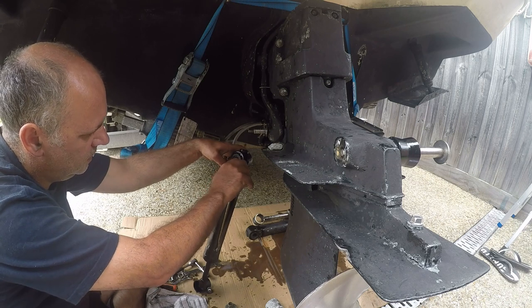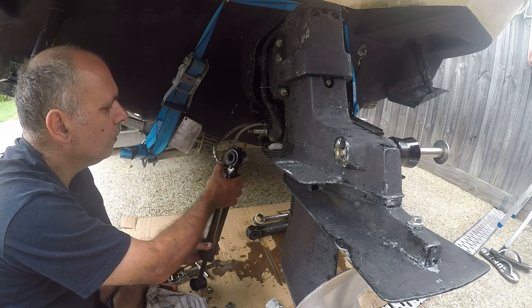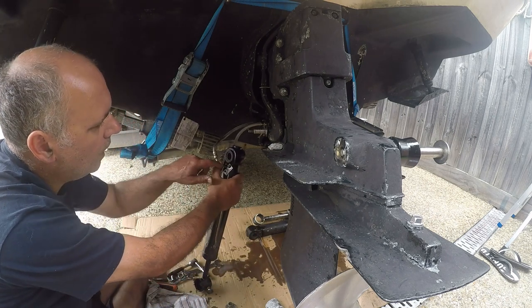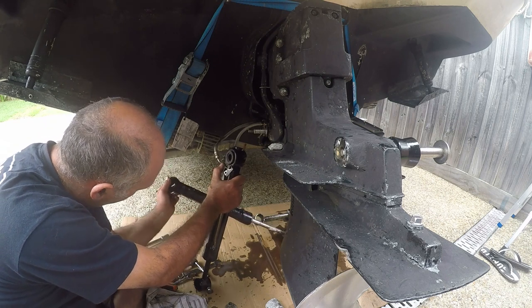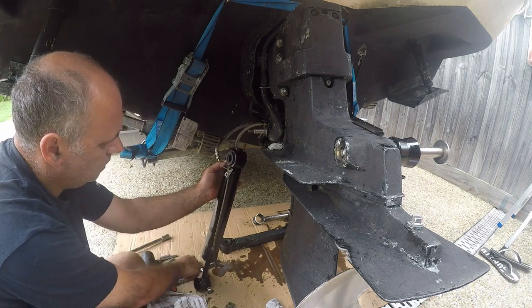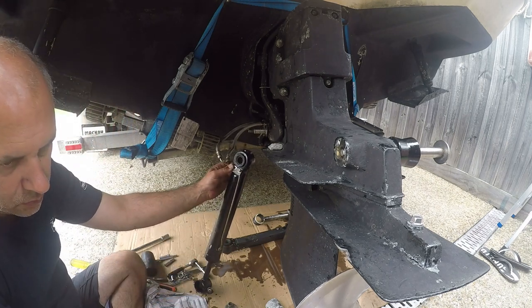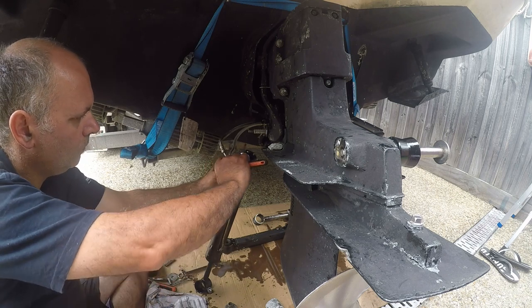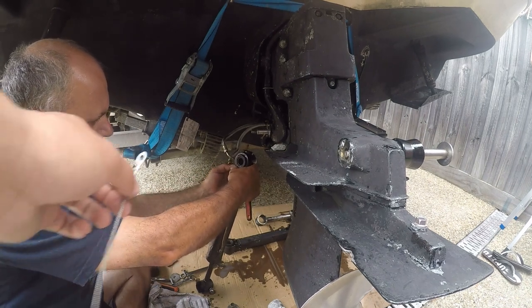I think these rings are slightly different. Yeah, they're a superseded part number. They're slightly different in the holding location right there. If you look at that between there and there, there's like 4 mil. Look at this one, got nothing. There's like 2 mil. That's why these are a little bit tight. Is it tight once you do up the line? It slots in. Have you got that other continuity cable? Yep. Did you use the fresh bolt on that side? Yep. Do you need another one? If you've got it. I've got the one from the other side if you need it.